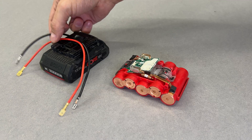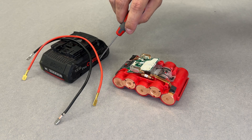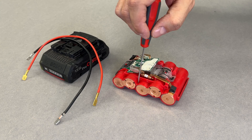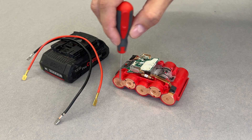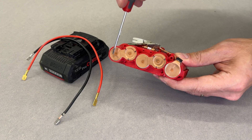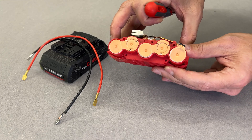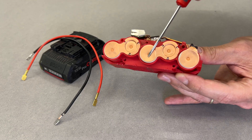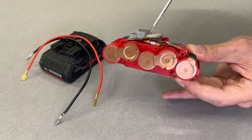Before diving into the repair, let's revisit that genius idea of jump-starting. Just imagine — you will connect the 18V battery to the 12.6V battery. 12.6V because only three cells are working and that's their full state of charge voltage. So where should the remaining voltage and current go? In the best case scenario, it converts to extreme heat on some components, potentially causing spot welds or melting.